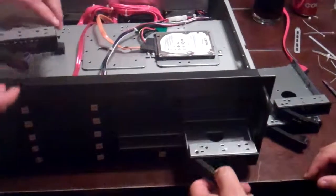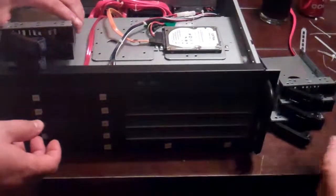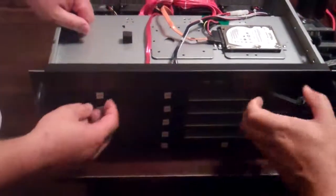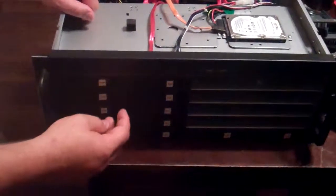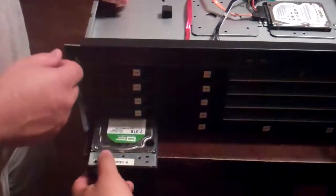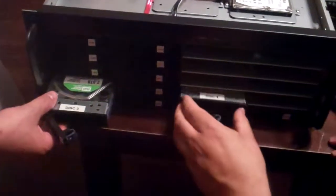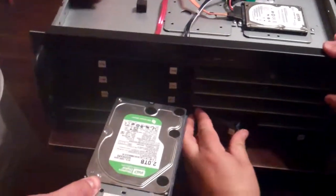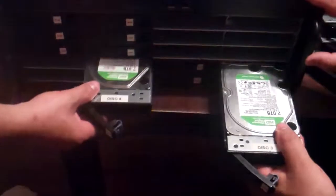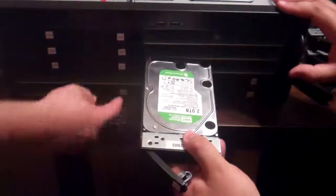You don't need to support this, do you? What's that? Well, we should get them all on PCI Express or the mainboard, right? Yep. It doesn't matter which way they go in or where. No, because Unraid is a dynamic volume, and you can actually dynamically reassign the drives. As long as you put the same serial number back in the same Unraid slot, it doesn't matter what controller they hook up to.